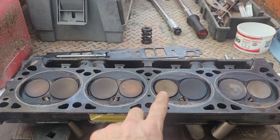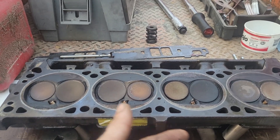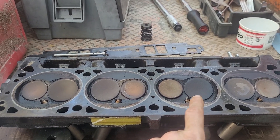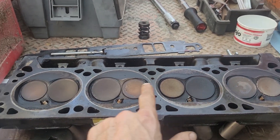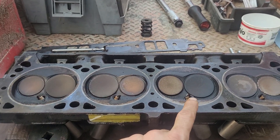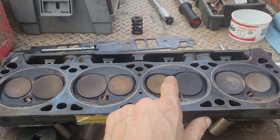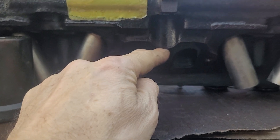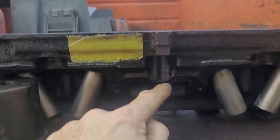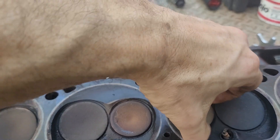What I did here — I have the head off, and I just filled each of these cavities here with gasoline. I leveled this and put gasoline in each one of these, and then I was able to see that, indeed, my number 6 cylinder's gasoline level decreased and decreased and decreased, and I could watch it coming out of the exhaust port right here. So that led me to looking at this valve right here, which is the number 6 exhaust valve.